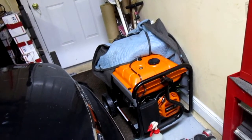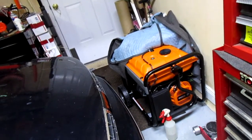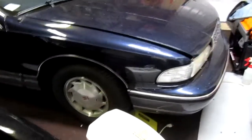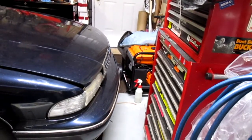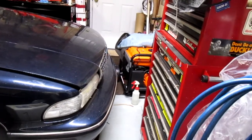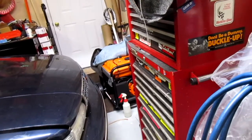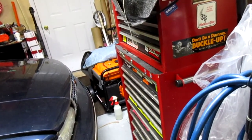How do you build a fuel tank that rusts in two months? I looked up the part number — a replacement fuel tank is like two hundred and thirty-nine dollars. It should be warrantied out, and with a couple of phone calls you can probably make that happen. My warning about this product: it's probably going to rust on you and when you need the generator most, you'll have rust at the bottom of the tank that will plug up your fuel filters and possibly your carburetor. It shouldn't have rusted this fast, but it did.